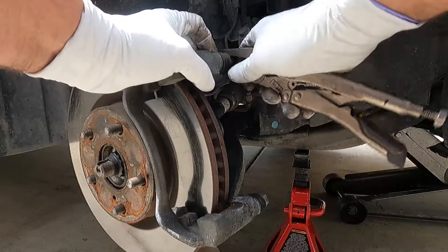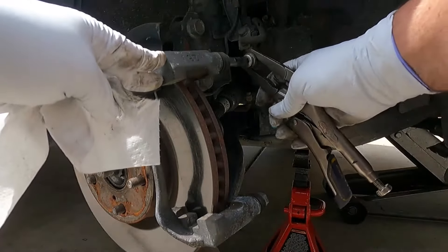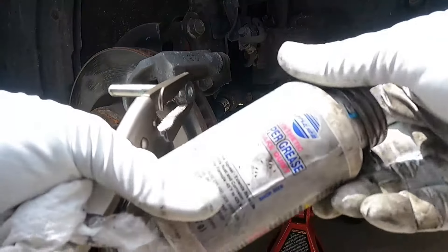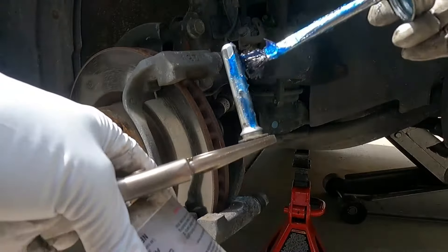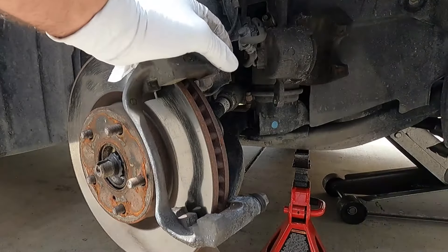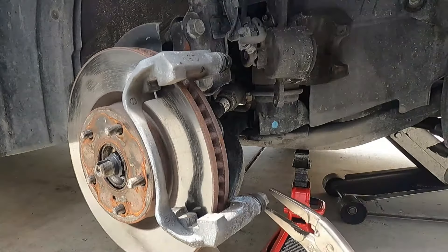We're going to clean and re-grease these slide pins. These are kind of stuck in there. A lot of times you can put one finger on the rubber boot and pull — and there we go. We're just going to clean these up as best we can, wiping off all the old grease. I'll use the slide pin itself to help get any excess grease out of there — put it back in maybe one or two more times and that seems to pull out more of that old grease. This is the new grease I'm using for the slide pins, it's this Versachem — a pretty blue color grease. Just brush a nice coat on here, then we can put this back in. As you pull it back in you kind of have to squeeze the rubber boot, and that burps out the air. It's already spinning and moving really good.